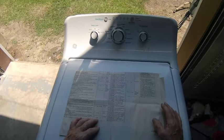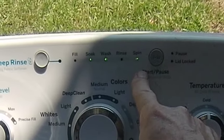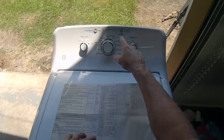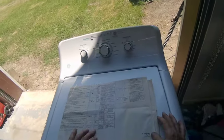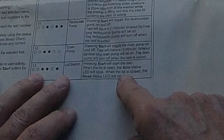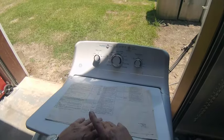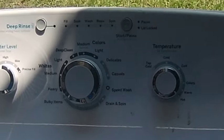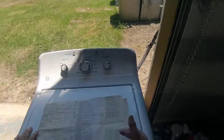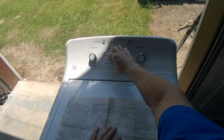So we're going to test the lid switch next. One more turn clockwise — this light, this light, this light should come on. Push the button and now the rinse light is flashing. It says: pressing start will start the test — when the lid is open the spin status light will blink, when it's closed the rinse status will blink. So rinse is blinking — let's open it. Now the spin is blinking. So it's not the lid switch, but it could be the lid lock.